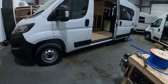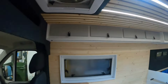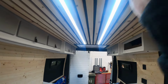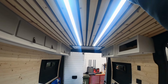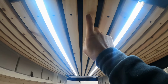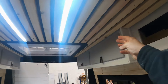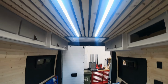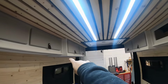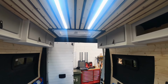There are so many ways of adjustment, because a lot of the time you're fighting against the van, because the van isn't perfectly straight. When we do the lats, we do them in the middle. Everything on this top is marked off this lat, so everything's 18 all the way to there. I guarantee, because I've done that many of them, it looks perfectly level. But this end cupboard is different from that end cupboard by about 20 to 30 mil.